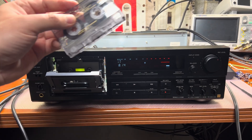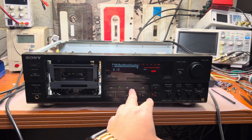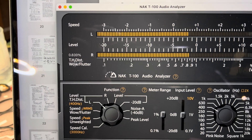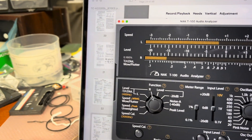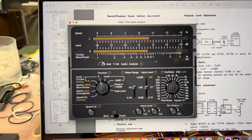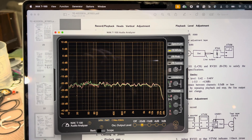Next, chrome tape - Type 2 - which was the most problematic. Let's see the recording levels. THD: left channel 0.8 percent, right channel - here's the tape - 0.9 and 0.7 percent. Recording is flat from minus 20 up to 20kHz. I can zoom in so you can see the good results.